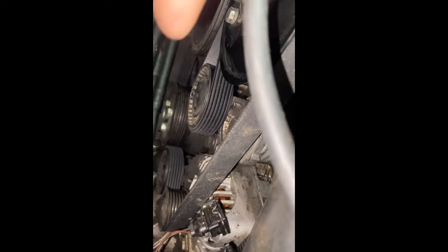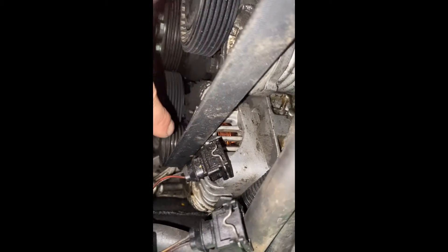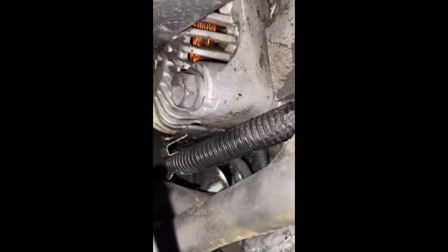See how you put a star socket in there and then you're able to fire the tensioner. You push the wrench this way and it'll push this guy this way and release tension. Then you're able to get down to here and undo it. That will free you up to be able to hit the bolt that is hiding behind there, to get this last piece off and then into the disassembly of the scary stuff.